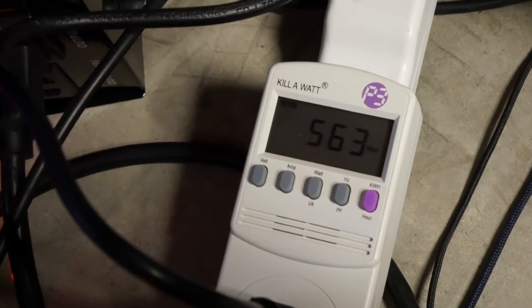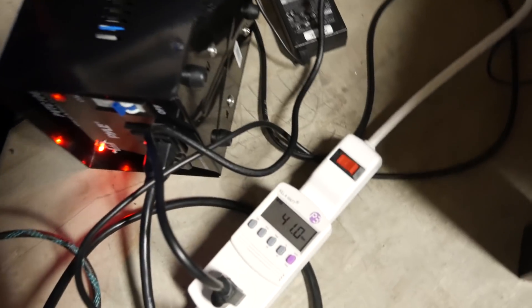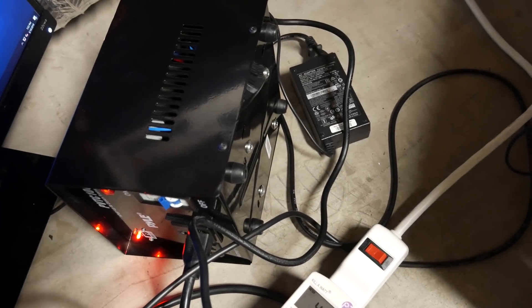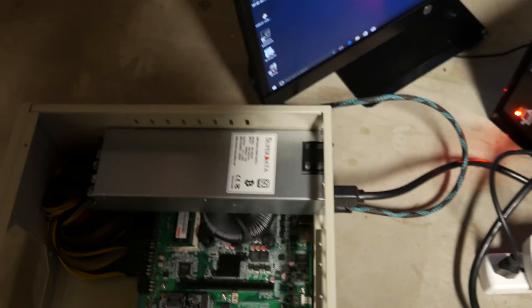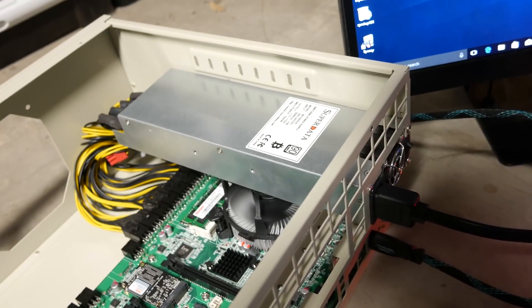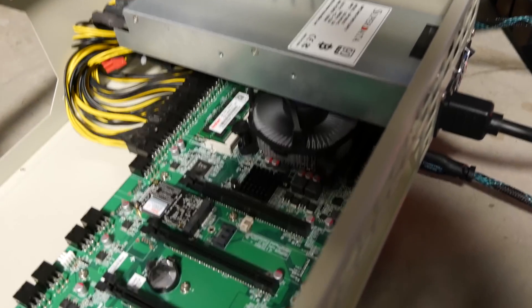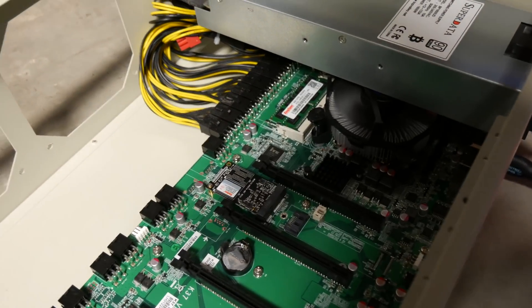The temperatures look pretty good — the 1080 runs a little hot. Now I want to check idle power with all video cards removed. With no video cards installed and just the system running, we're drawing 41 watts total. Accounting for the inverter drawing about 14 watts, the system itself only draws about 28 watts — which is impressive considering it includes a fan cooling the power supply, the motherboard, RAM, and SSD.